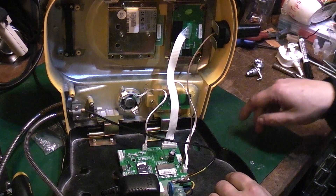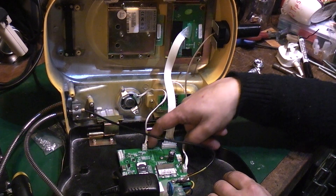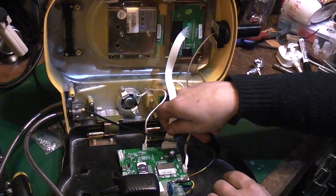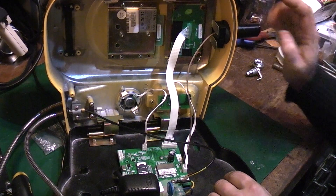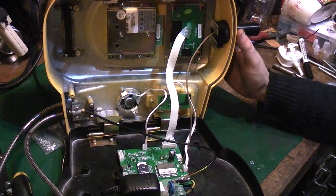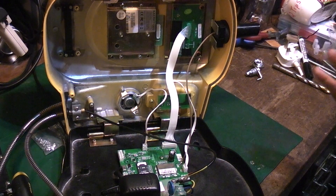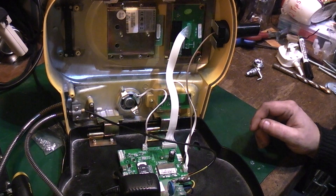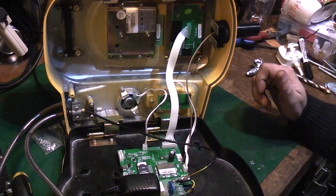You can actually see down there — there are little bits of wire and solder on that connector, so it's not a blind unused connector. There was either a connector or, more likely, a ribbon cable on there that went up to the keypad. Before we can go much further, I'll have to make something up to replace that, otherwise we won't be able to use the keypad to dial a number or access any menus. I really don't know how advanced the mobile phone part of this will be — it'll just be a basic call-only style phone, you won't be able to text on it.